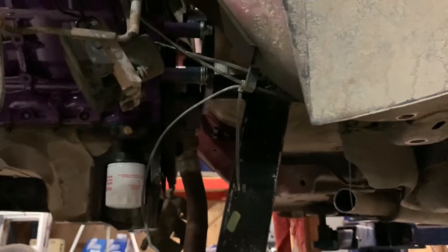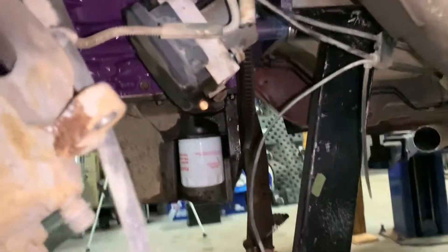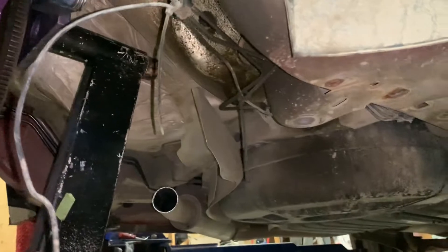As for space, we have a pile of it — there's lots of space up here for the engine, lots of space for a manifold. The intake pipe comes down here fine. I just have it on an engine stand laid there so I could look at it and size it up. Looks like lots of room for the transmission too. What I'm going to do is bolt the engine and transmission together, lay it all in place with an engine crane, then bolt the K-member up and see what I've got. This is still in the very early stages.